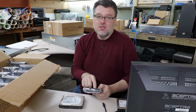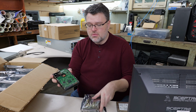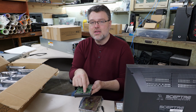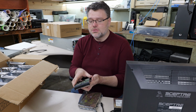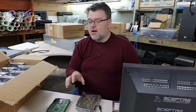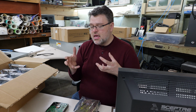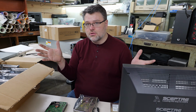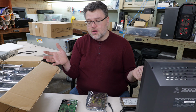So with SATA, you only have the one connection on the drive, but with SAS, there's actually two connections. The controller on this drive can be connected to up to 2 different controllers. This opens up some really interesting possibilities in terms of being able to connect this one disk shelf to a bunch of controllers. If you've got advanced software, like TrueNAS offers commercial software, this is not the free TrueNAS, but this is a paid for one.